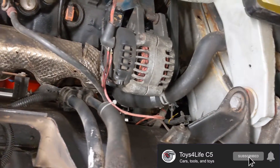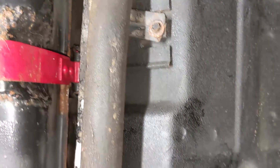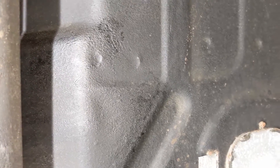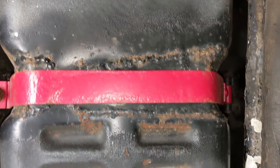I've been under here for about 20 minutes, cycled the key a few times and I'm not seeing any leaks anywhere, but when I look under the car about where the leak was I do see some minor evidence that fuel has run down from the top of the tank down the side of the space frame and off the floor. I'm not going to risk it - I'm going to go ahead and pull the tank. I don't know if the lines are coming loose from on top or if there's a leak up there, but it's time to drop the fuel tank.